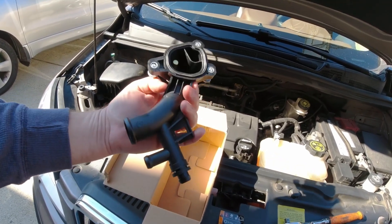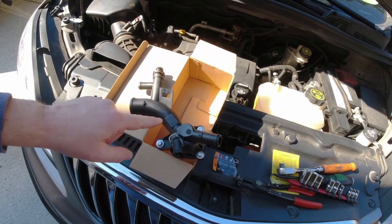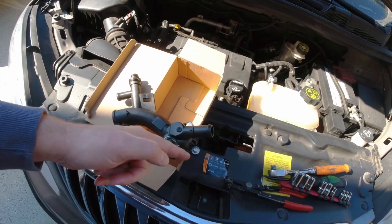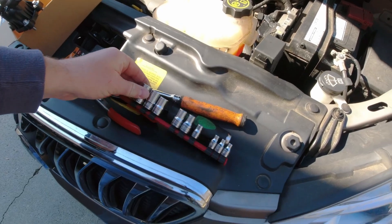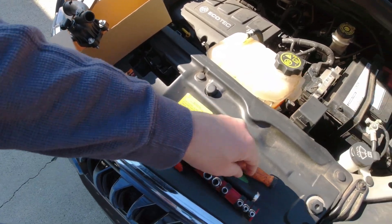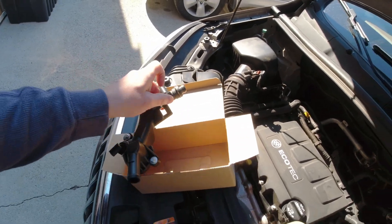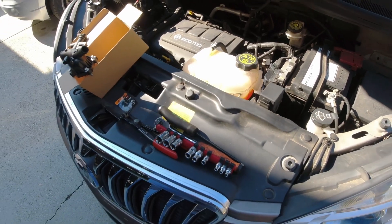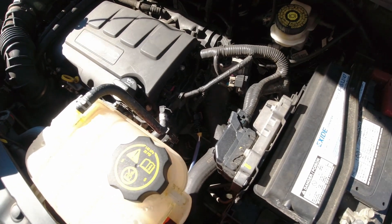Some of them are a little more, just depending on what brand. This one's a Dorman, you can get an AC Delco — they're all about the same. This one comes loaded with a sensor, some sort of a restrictor, and we've got a couple water hoses we're going to have to disconnect. We've got some inverted torx — so you use sockets like these, these happen to be Snap-on but you can probably get them in any brand. A pair of radiator hose pliers, and I always like to have a handy pick for getting hoses off or undoing these quick clips. Of course you've got to have a ratchet, probably going to need some extensions.